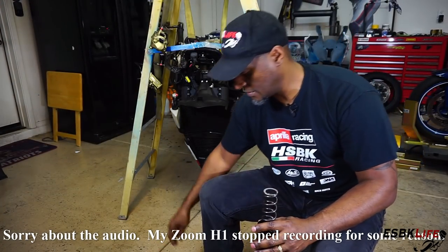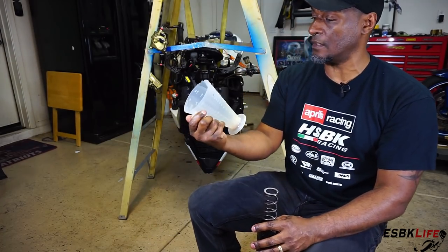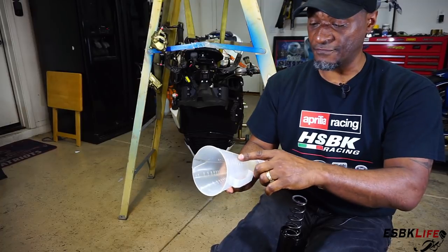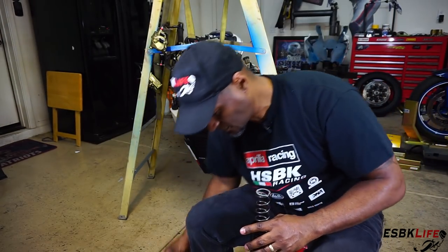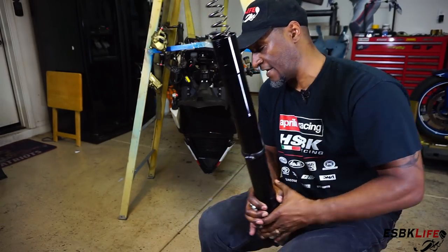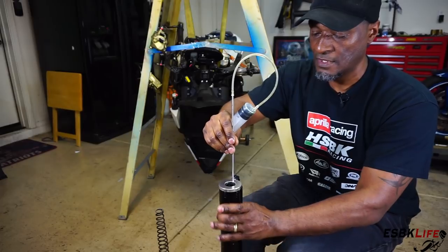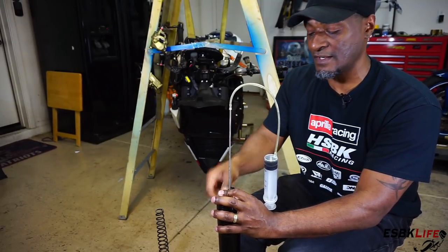I have my fork, my Ratio Rite, my measuring syringe, and my fork oil. I'm going to fill the Ratio Rite to 500cc's, pour it in, then fill it to 220cc's and pour that in too. The manual also says 720cc's is approximate — what you want is an air gap of about 70 millimeters from the top. I've already set my syringe to the appropriate line. After we fill with fluid, we sit the syringe right on top and operate it to suck out whatever excess fluid there is. Once it stops sucking out fluid, I know I have the proper air gap.